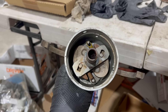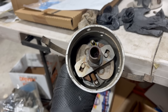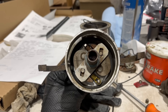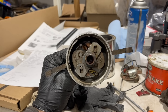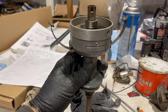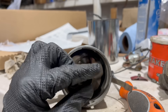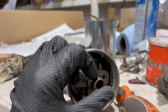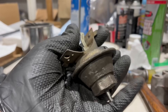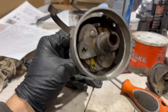In case you don't know anything about distributors, I'll give you the Cliff Notes version. Basically they make sparks happen — but in a slightly more detailed way, they make sparks happen at a given time based on various inputs. The engines we deal with want spark advance: they want the spark to happen a certain number of degrees of crankshaft rotation before the piston gets to the top dead center position. We accomplish that with three different things: base timing, mechanical advance, and vacuum advance. Base timing is set by where you point the distributor body. Mechanical timing is controlled by these weights and springs — the faster this thing spins, the further out the weights go, and the more advance you get. Vacuum advance is controlled by this guy: a hose from your carburetor sets the amount of vacuum going into it, which changes how much advance you get. With no springs at all and a broken vacuum pod, the distributor I took out did none of that stuff.